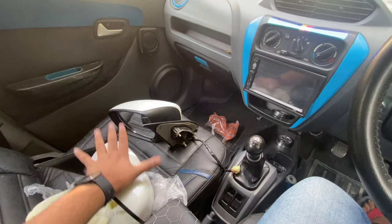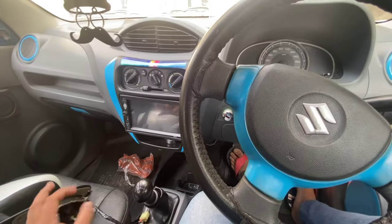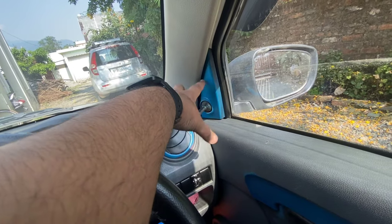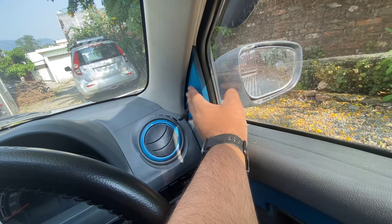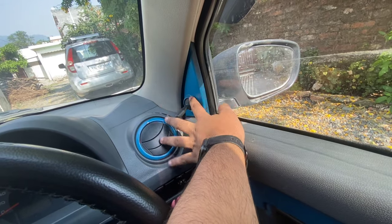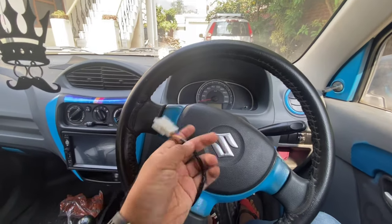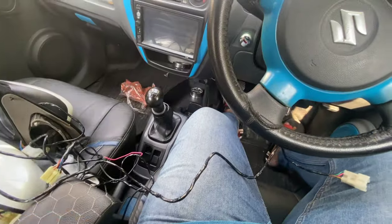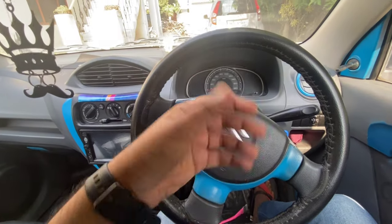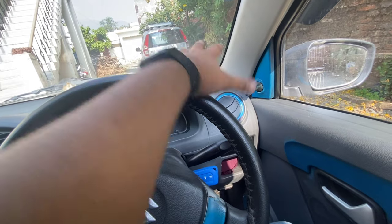As you can see, we have unboxed the mirrors. There's a space for the joystick but we don't have a joystick — it's all auto-folded. So instead we'll install a switch here. This is our indicator wire and this is the mirror coupler — it will attach directly to the mirror. With this you'll get the pink wire, which is the indicator wire. You can attach it from here or from the front fender. We'll wire it in when we remove the indicator.